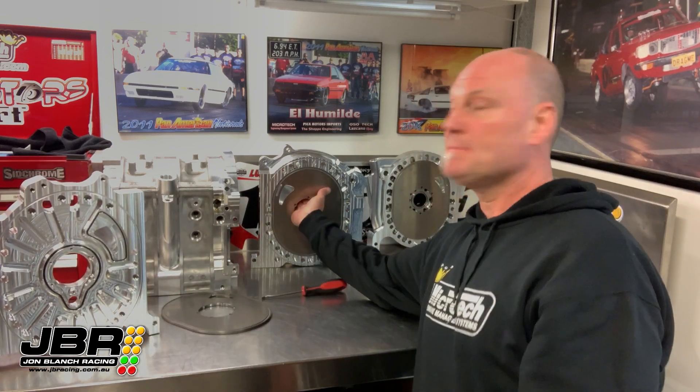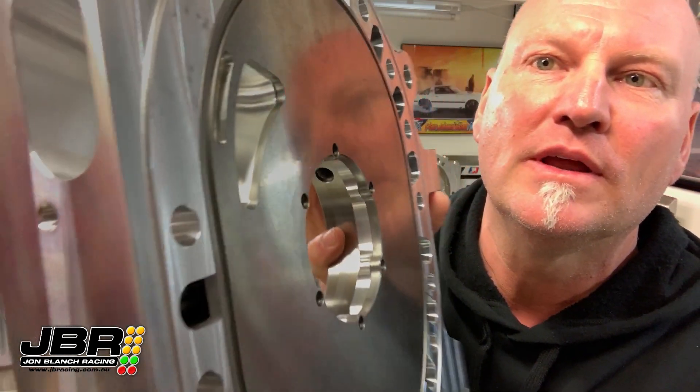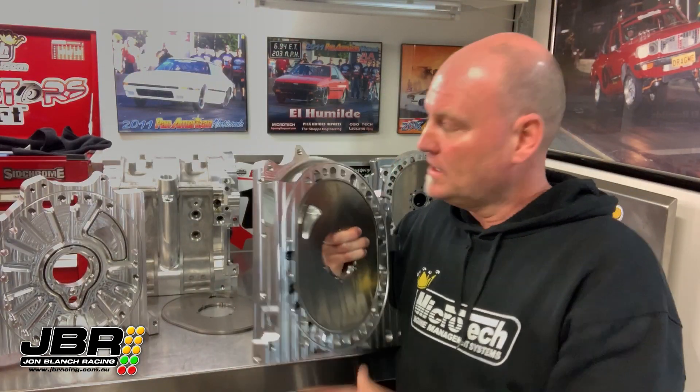Now onto the porting. I personally get all my ports done on the 5-axis CNC, which is one of the best things ever because I hate porting. As you can see the CNC porting looks pretty damn flash, and because they're done on the CNC each port is identical — I don't touch the ports with a grinder, I leave them exactly how they come off the machine and put the engine together. I could spend a week swinging off the die grinder and I would never get them as good as the CNC can. They're good enough to run mid-sixes and 213 mph in Steve Barnett's car just the way they are, so I'm happy to leave them like that. If you are one of those guys who likes to do his own porting, it's not a problem — with these plates you can grind the ports and it's not going to affect anything because the insert is cast iron, just like porting a factory cast plate.